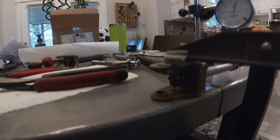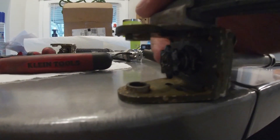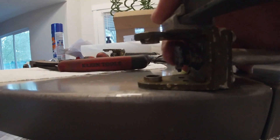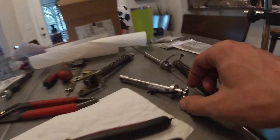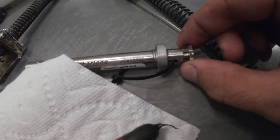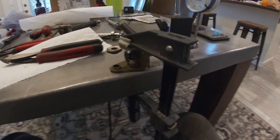Next, I'm going to set up the same dial and try and get a measurement of how far the sprocket is moving. If you can see that, look at all that play. Compared to the new one — which is an easy test — it doesn't move at all. I'm excited to see what that number is as well. I'll be right back.